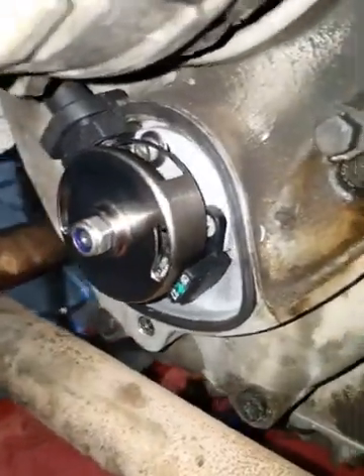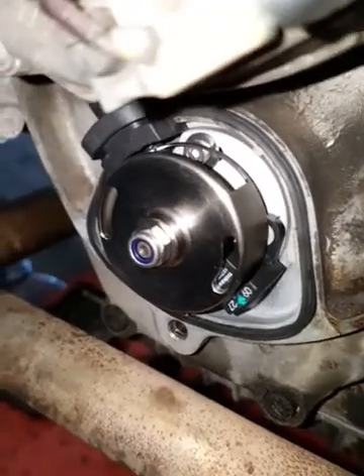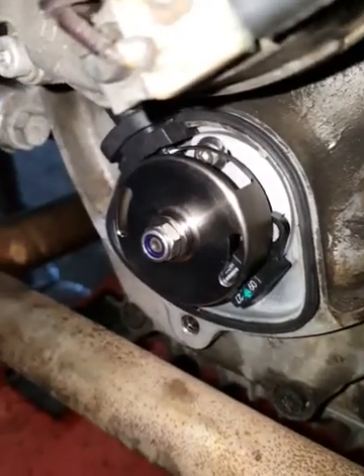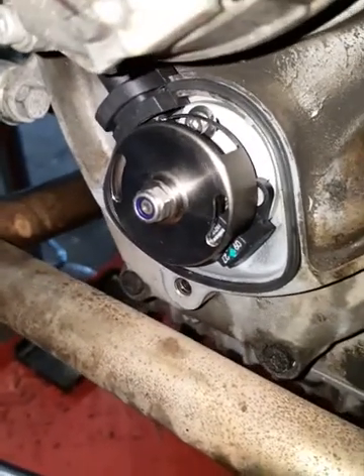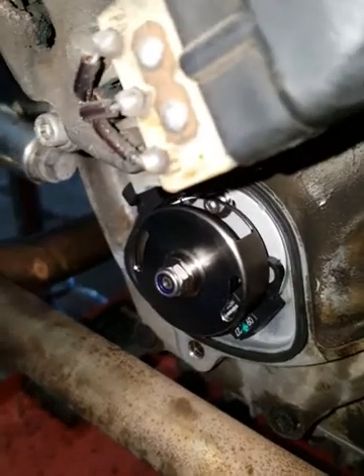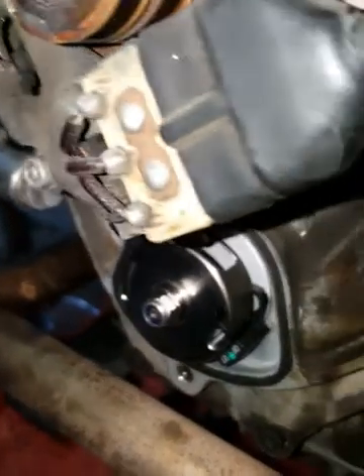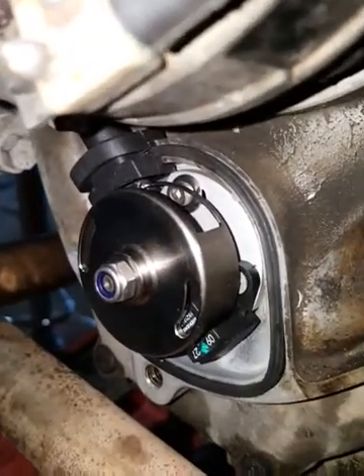There's the hall trigger unit right there — you can see it very plainly. It's almost exactly, in fact interchangeable with, the standard cam. You can buy them from electrical supply stores; I believe they're made by Honeywell. With no real hassle you could change that just as quickly as you could change a set of points.